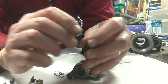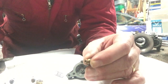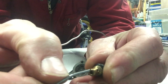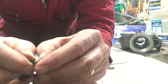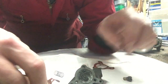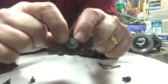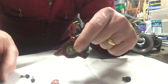You can check that the valve works by just getting a small piece of wire — I can just see the spring moving ever so slightly, so I know that that works. That gets screwed into the top of there; there is an O-ring around the top of it just to make sure there's no air leakage. When you put this together it's important to put the spring behind the diaphragm, so you have the spring and then the diaphragm. Make sure all the port holes are in the right place, then you have the gasket that goes on top of that, and then it gets bolted onto the carburetor using three screws.